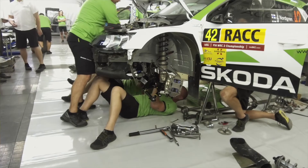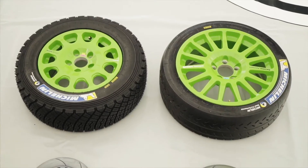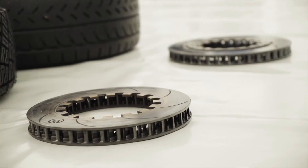When we go from gravel to tarmac, the car is more stiff, so it will be more rigid and more reactive. As we change the diff setting, the car will be less sideways, more neutral or a bit understeer for the tarmac. And the brakes will be more efficient, so the driver will be able to brake later, like proper track racing.